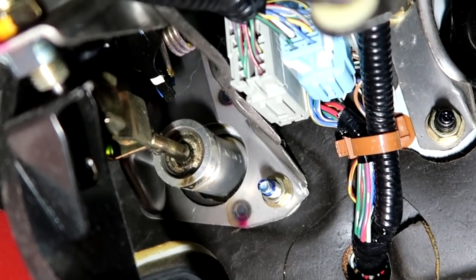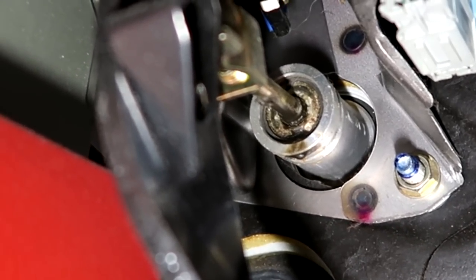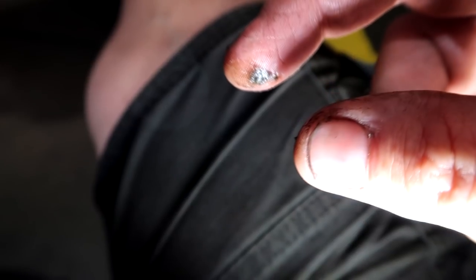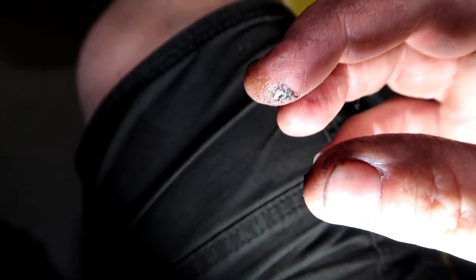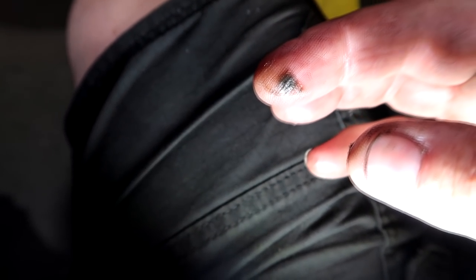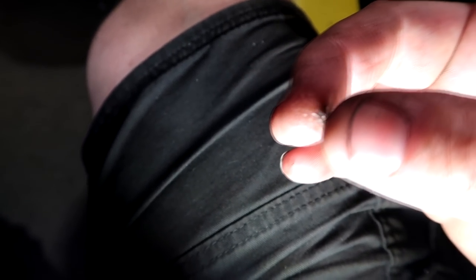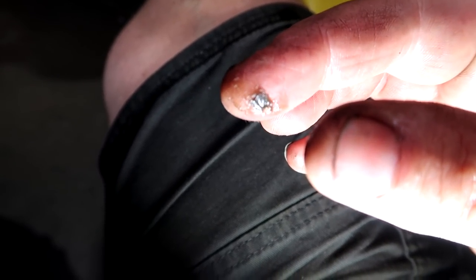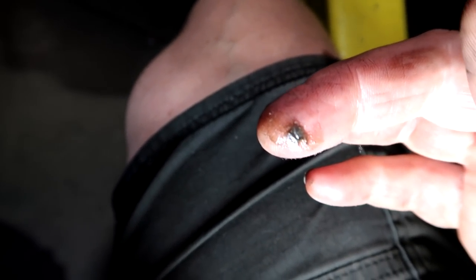So you can see where it's had like a drip, but it's not wet — it looks kind of questionable. What came off is like grease, not fluid. So it's not terrible; it's not 100% but it's not bad. I don't want to just charge a customer to replace that — there's actually nothing. If we put fresh fluid in it's probably going to be fine. It's grease coming out of there, not actual brake fluid. If it were brake fluid it means it's passing by the master itself — but it's not, so we'll go ahead and leave that one.